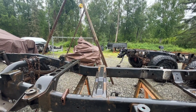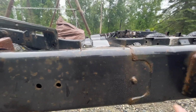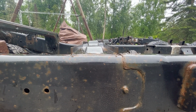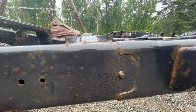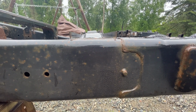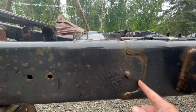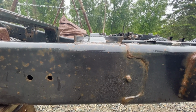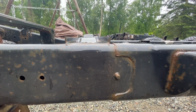Getting ready to start on this second half of the frame with the cutting. Just wanted to cover something real quick with you. So cutting out these welds and whatnot, I've done 4 of them now, in both styles: one where I want to keep this section, and the other where I want to keep the internal section. After doing both, I found the easiest method, honestly, is to cut the metal close so I can move the frame away and then work on the rest of the welds, grinding them down and making cuts, and maybe even making cuts inside the tube just to break them loose a lot easier and get rid of that piece inside.